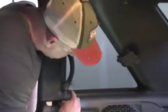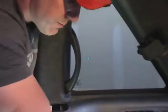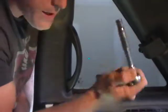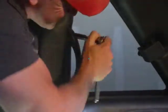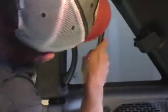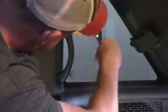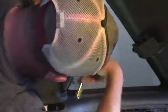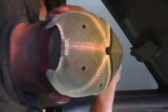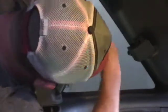I took the opportunity to pull one of these plugs off because this grab handle does have to come off to pull this panel loose. We're not going to pull the panel completely out of the truck — there's really no need to because the lower panel itself is already attached to the body really well. You're going to need a 10 millimeter wrench; you can get a socket in here to get that 10 millimeter nice and loose.